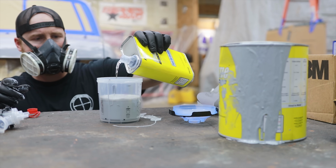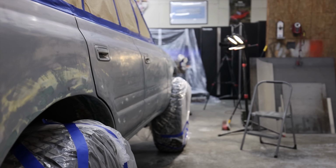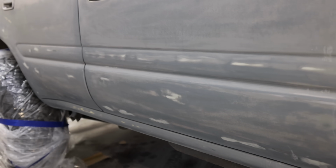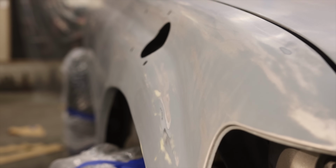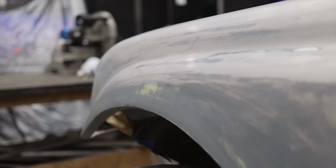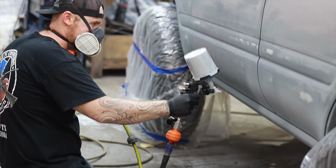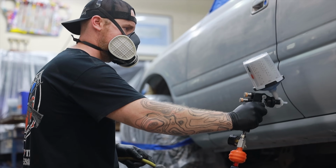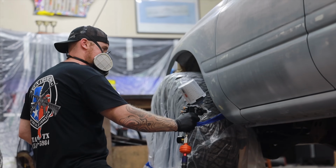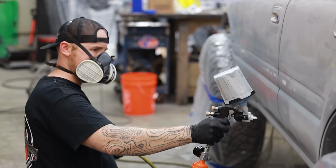One thing that I did forget to mention about primer is that one of the goals here is that we want our top coat, the actual color, to have basically the same surface to adhere to throughout the entire paint job. It's not necessarily because it's gonna stick better. It's because we want it to be super consistent. We don't want any weird dark or light spots. We don't want somewhere that one type of body filler is kind of soaking in some of the paint and making it look weird. So this needs to be a smooth finish that's all one color that we can then apply our top coat on, in hopes that it's going to adhere well and evenly, and that we're not gonna have anything too glaring that's gonna shine through this orange that we're inevitably gonna get to and spray on here.